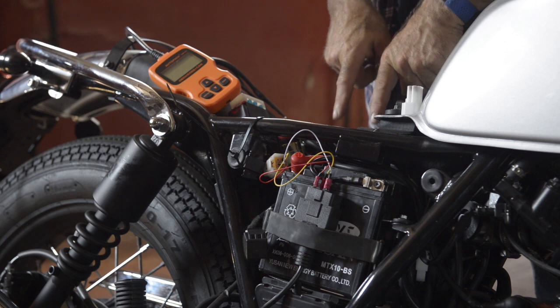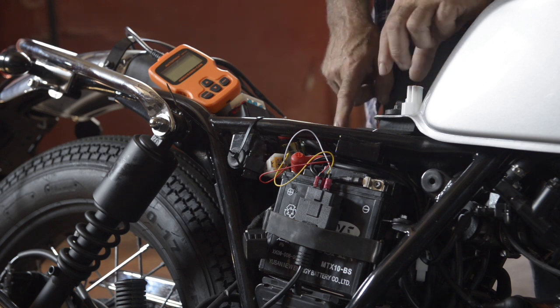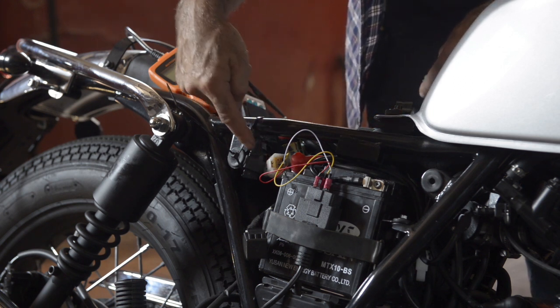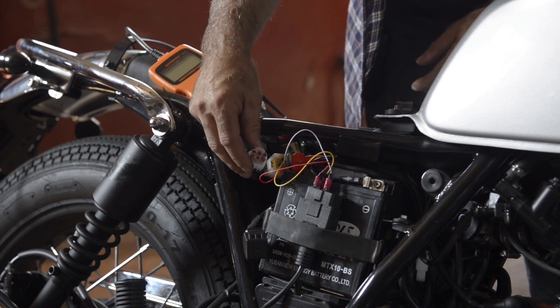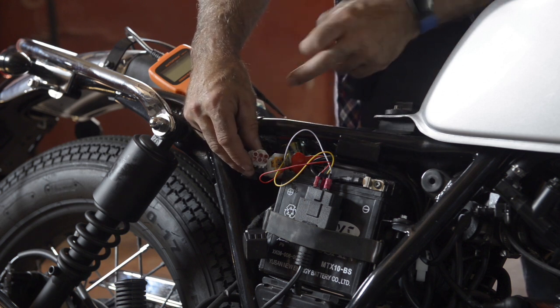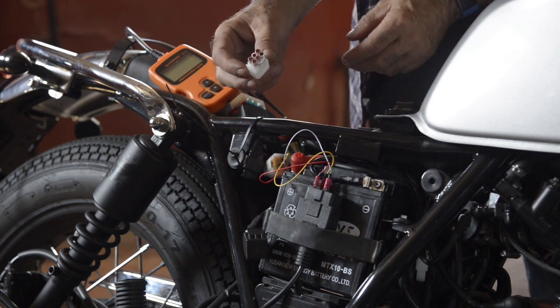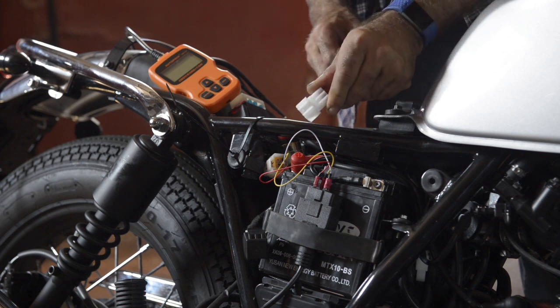The ECU is fitted right here, just behind the gas tank. And the diagnostics connector is over there. So look in between the battery and the frame, and it's sitting over there. And you'll see it, it's been plugged up with this kind of connector. Now the good thing is, this connector you can later use to make a proper cable. So don't throw this away, keep it aside.